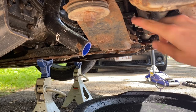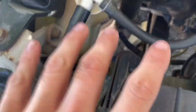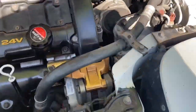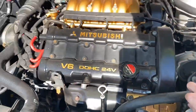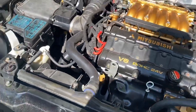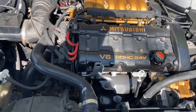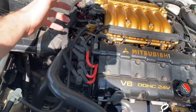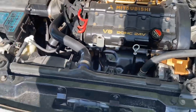All right, as you can see we have towels stuffed in there. We're moving the whole radiator and fan assembly as one. Any plugs you see — there are two here and then one right here — those are connected to the fans, and there are some plugs down low. We'll get started by removing these. Next we're going to remove this radiator hose. There might be some excess coolant laying around since it's kind of a flat surface that dips down, so when you loosen this, take it off and bend it over — maybe even throw a zip tie on it so it stays up when you put in the new radiator.